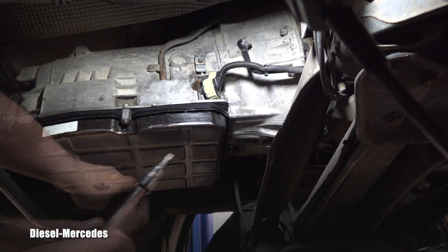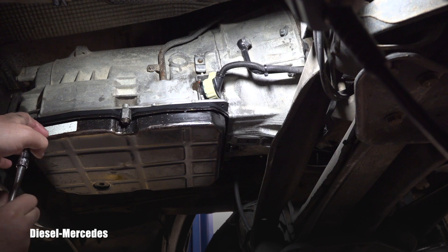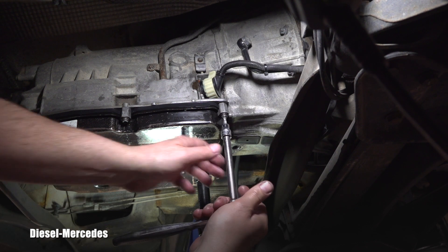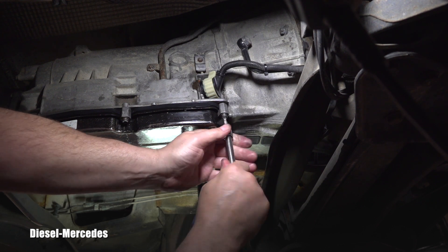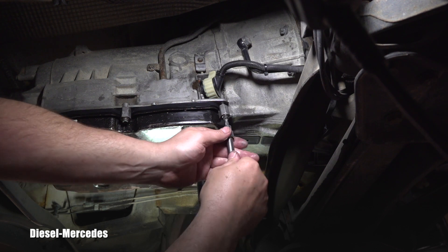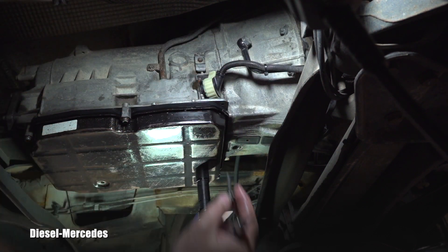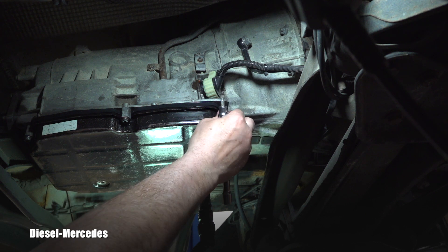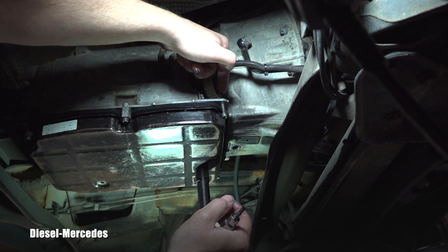If you won't listen and want more torque, you will not stop any leaks. Look at this — I just found that this bolt right here is stripped. I pulled it out and it ripped its threads. Somebody torqued it too much and damaged the casing. Now I have to hope I will have enough space right next to that connector.